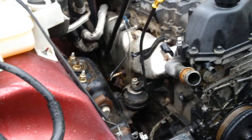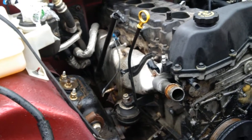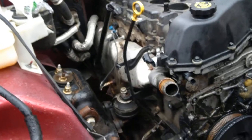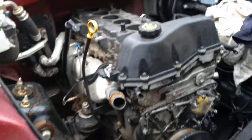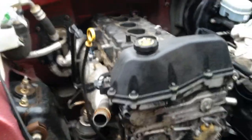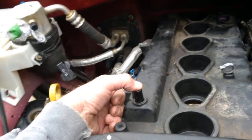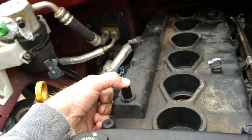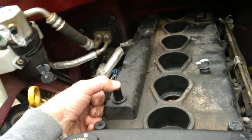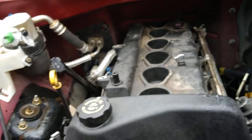Eventually this one grenaded. It sounded very much like a diesel and had an interesting knock in the top end — a funny sounding knock. When you plugged the PCV hole, after 30 seconds the knock would go away. So that was the diagnosis: it's falling apart inside.